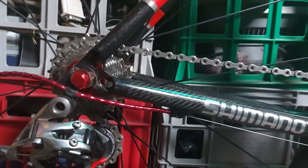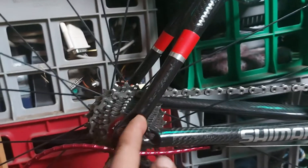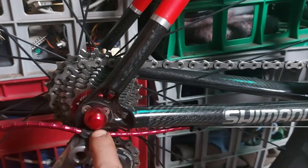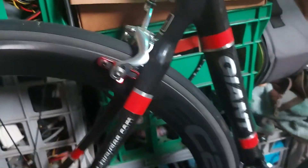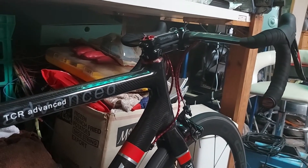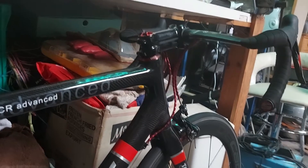I'm not sure whether the cable will run down the chainstay or maybe the seat stay. There's a blind hole up here which I wouldn't have to put a grommet in if I went that way. Since this kind of points down, I want to seal that up if the wire's coming out here. Not sure whether I can get through there. Also not quite sure what I'm going to do with the A-junction — it's the normal under-stem one, but it's going to be stashed inside the bars or the stem. It's going to be tricky.